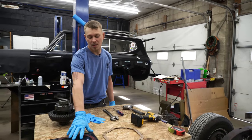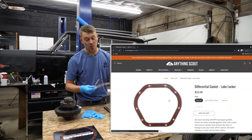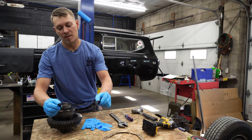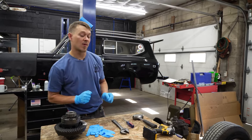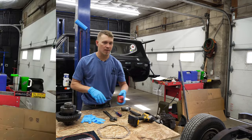These are two different style gaskets — you only need one, obviously. This is your regular paper style gasket; it comes with a lot of rebuild kits or you can buy them cheap. We like to use this style reusable lube locker. They're very durable, reusable, and don't ever leak, hardly. And lastly, probably just a flashlight so you can look inside — it'll help you out.